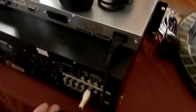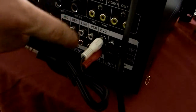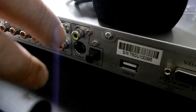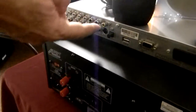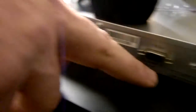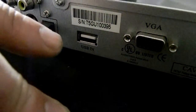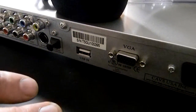We do have different cables available in other auctions if you need them. On the back, I've plugged in the laptop cable — also called an iPod cable — and there's another channel that allows you to plug in the karaoke player. Up here you'll plug in the RCAs in the far left corner for video. Take the RCA cables, split the yellow off, and plug it into whatever TV you have. If you have a VGA cable, you can plug it in here as well. Here's the USB port, which allows you to hook up a thumb drive. If you need us to point you in the right direction on tutorials, we can do that. This pretty much goes over the K1 economy system.